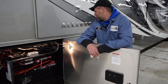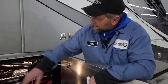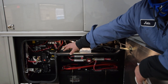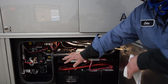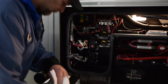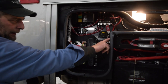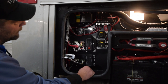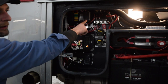Back here we have the rear passenger side storage compartment — it has a lot of stuff going on in here. Most of the stuff over here is all chassis-oriented. Any flashing lights and so on, that's all sensors for the engine compartment and transmission. To service it, it's more Cummins dealer only or a Tiffin dealer. Some things to check for if you don't have power is reading the labels over here and making sure these indicators are in the proper location. There are also fuses — big ATC fuses such as this in between each compartment.